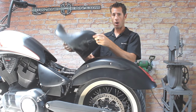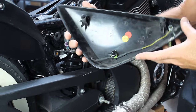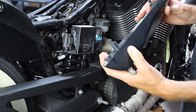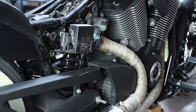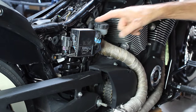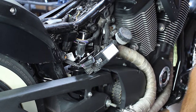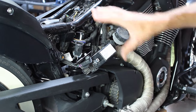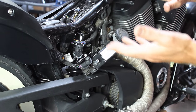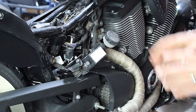I'm going to be pulling off the seats — I already took out the bolts to make it easier. Took off the side covers and we're going to get into removing the stock shock. We'll also need to remove this fuse box assembly by removing these 10mm bolts, so we can get to the shock bolts. Before removing components that connect the swing arm to the frame, it's really important that you make sure the bike is stable, strapped down, and that you take the tension off the rear tire so nothing binds or collapses when you remove the shock. Know your abilities and make sure you do things safely.